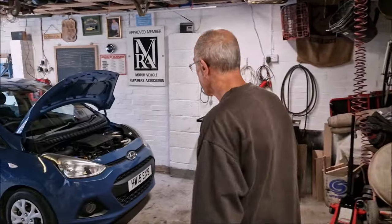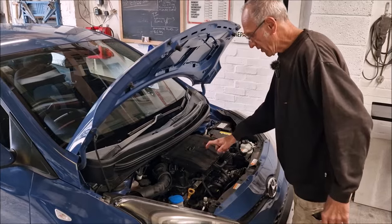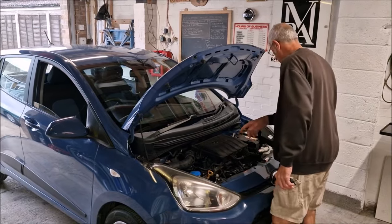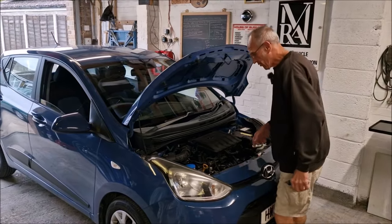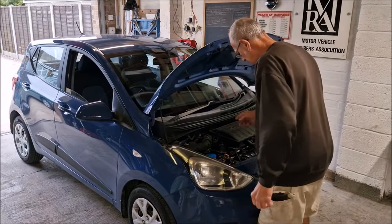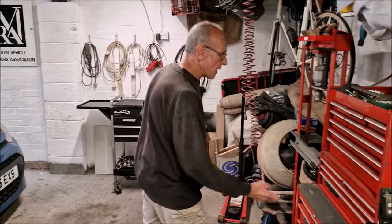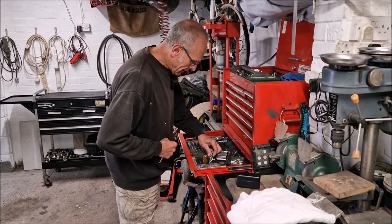Well, we might as well stop making this now. Just talk us through it quickly, then. What's the process? How do we do it? Air filter off, rocker cover off, alternator chucked forward, air conditioning compressor chucked forward, pulleys off. It says you take the water pump off. Okay, we haven't got a new water pump. No, I'm going to put it back on. Okay. Disconnect the battery first, wheel off, under tray off, engine mounting off, support the engine, then take that front pulley off, take the cover off and see what we've got. What do you estimate that to be time-wise if we were doing it in a real-world scenario and not cocking about on YouTube? I don't know, really. I don't know, but we'll soon find out.